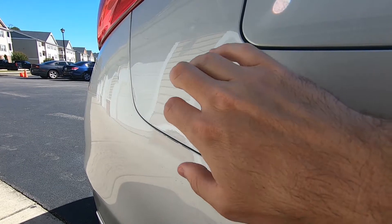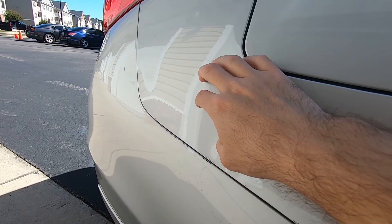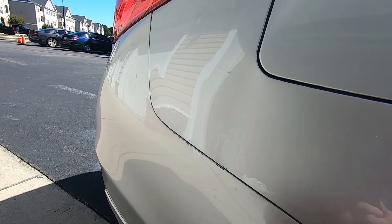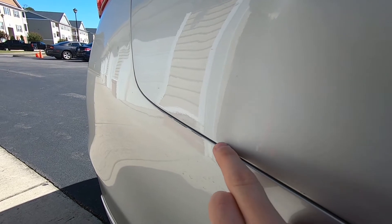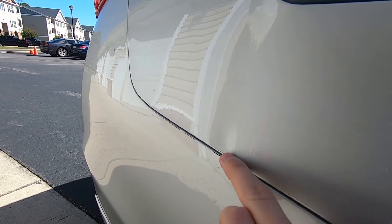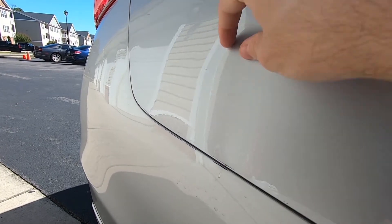This is causing this nice little dent here. The issue with this dent is if I smack up top here or suction it with a suction cup it'll pop out, but the moment it's touched it sucks back in. The reason for that is down here at the bottom — you see this little section of paint that's missing — there is a small little crease right there going horizontally across the panel. That little crease right there is what's causing all the tension that is keeping this dent in place.